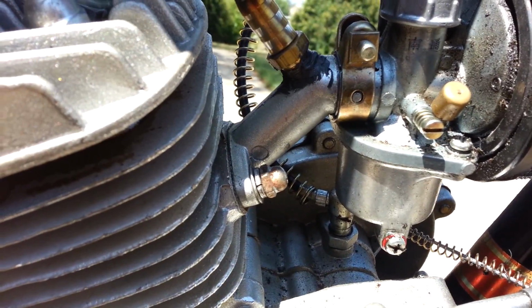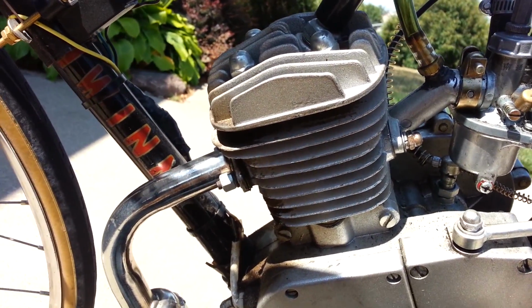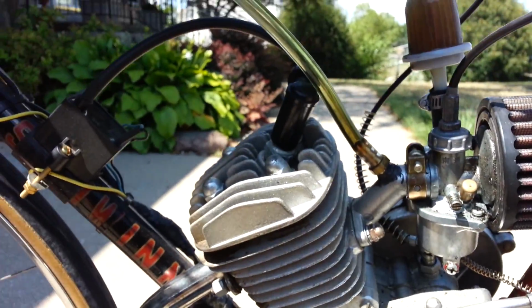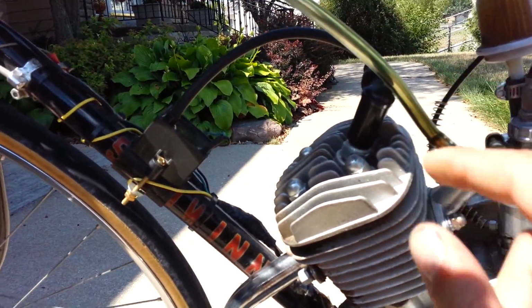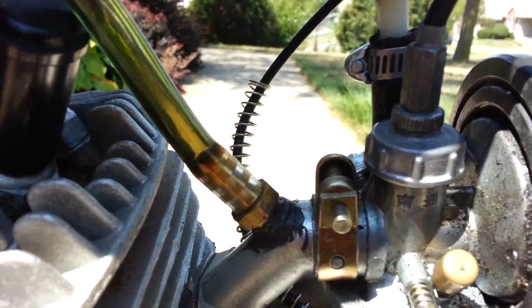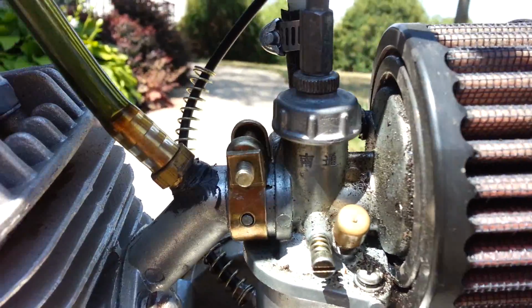As you saw, I didn't adjust the carburetor at all. The same amount of fuel that wouldn't even run this motor will actually run the motor with the boost bottle installed, because it catches the excess fuel and feeds it back into the motor enough to even keep an idle, which you saw right there. My idle is adjusted just barely up, and if I run with the boost bottle capped off, I have to adjust my idle way up, and I go through a lot more fuel.